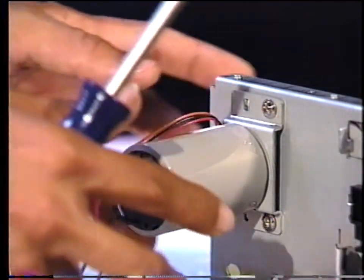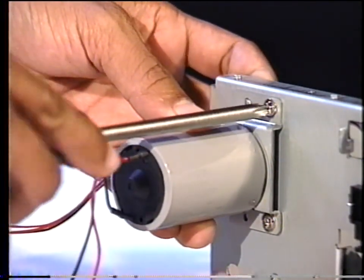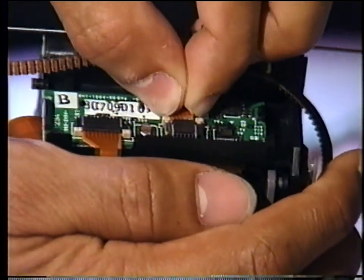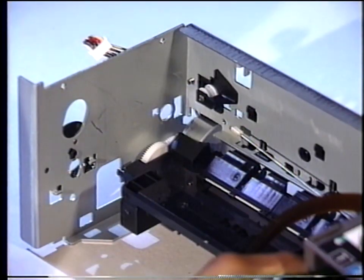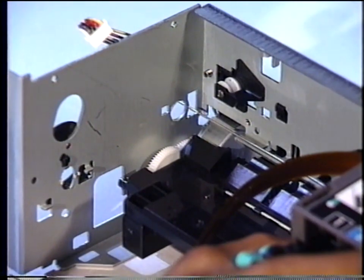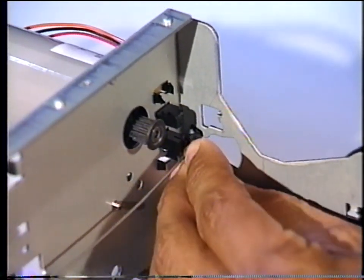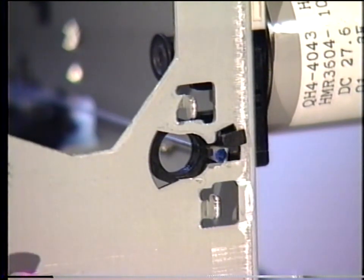Now that we're back, let's begin the printer assembly. Replace the home position sensor, the carriage motor, and paper feed motor. Attach the linear encoder and MR head assembly to the carriage unit. Insert the MR head's ribbon cable to the carriage PCB and lock the cable back into place. From the front of the printer, carefully replace the carriage unit — first inserting the left side of the encoder into the printer's frame, and then insert the right side of the encoder into the black encoder holder. The linear encoder's memory edges will only fit in one way. Attach the encoder holder to the frame of the printer. The flat side of the memory edge will face the rear of the printer.